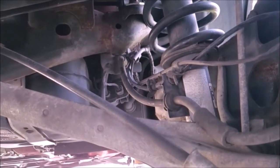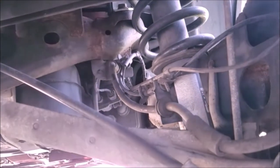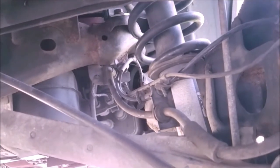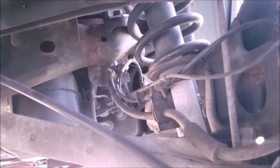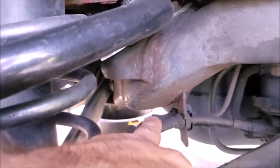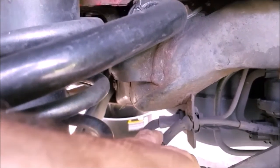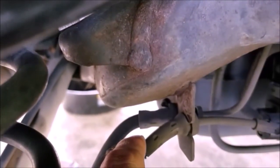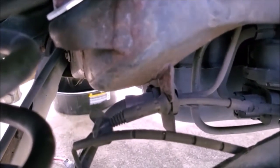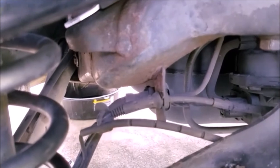Right here in the center of the shot you can see where that brake line connects to the hard line on the car — 11 millimeter nut on the hard line side and 17 millimeter on the factory piece, then 11/16 on the aftermarket one. Looking at it from the side of the vehicle, there's a sensor in the way, so if you pop the brake wear sensor out of its bracket, the brake line is sitting right behind it and it's a lot easier to get to.